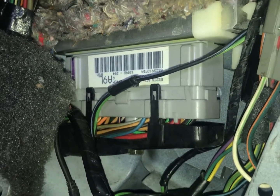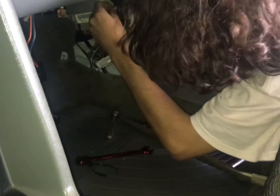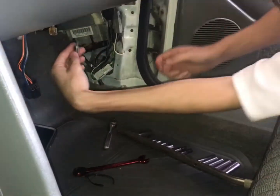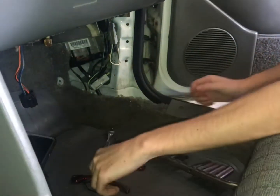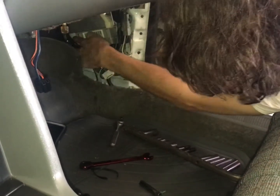With the blower motor case out, we have access to the Mustang's ECU. This will avoid denting the case and it'll actually make the process of removing this ECU a whole lot easier. It's a little green 7mm bolt, and then that box will just slide down and we can get the harness off. So much easier with that blower motor housing out of the way.